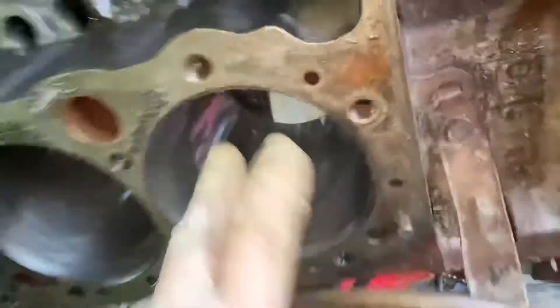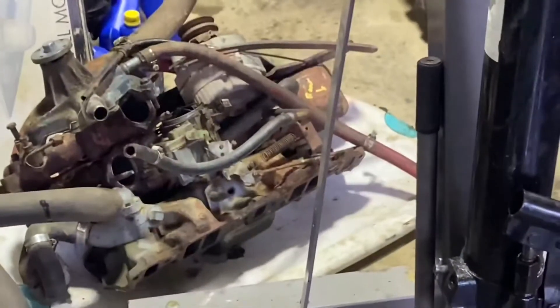We've got no crankshaft — the camshaft is still in there — so it's almost completely bare. I wanted to show you guys the honing on the cylinders. You can see how shiny the honing is here — this was a troubled spot but it polished up pretty well. On the other side, which we haven't touched, you can see how rough those ones are, but you can also see factory honing there.